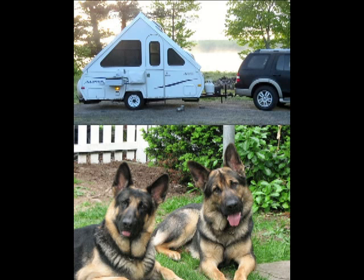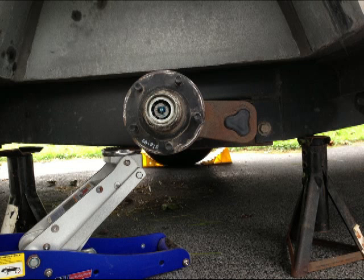After I did all that I decided I should probably put some time into maintaining it. So I took off the wheels and went to grease the bearings in the wheels and hubs, and noticed that the axle was on a negative angle. What that means is that the axle is worn out. This is called a torsion axle. It's an axle that has a rubber band or rubber plate inside it, and there's an arm on the end that when it goes up and down it squeezes or crushes that rubber — that acts as a shock absorber. So there's no other springs or shock absorbers on these axles. And I think after a couple of rough miles you can really destroy them.